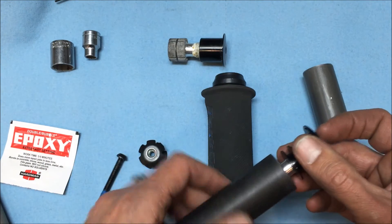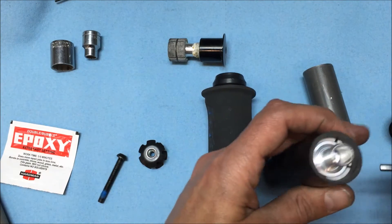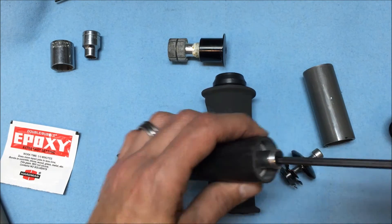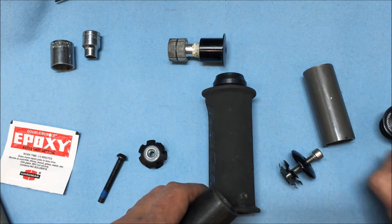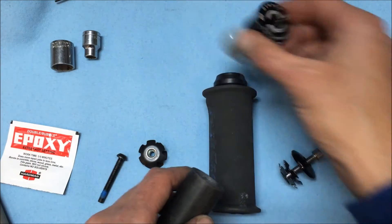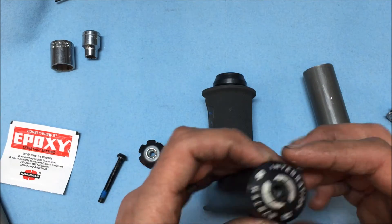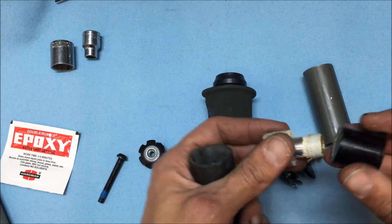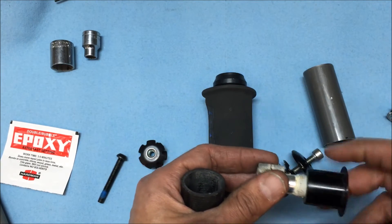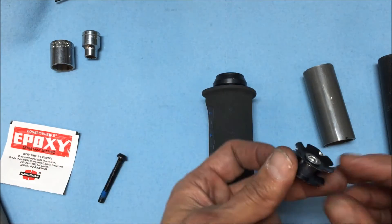Here's another style where you tighten it right through the center. This one's on a newer Cannondale Evo or CAD 10 — it's an older style but same thing basically. You just stick it in and tighten the bolt in the center, which I think is a 5 millimeter, and the actual cap is a 6 millimeter. That's basically how you secure that in place.